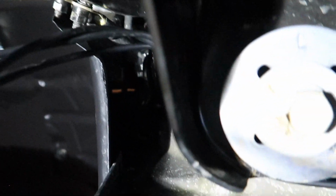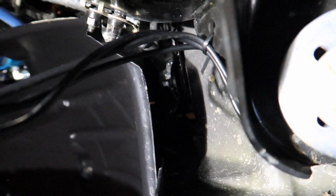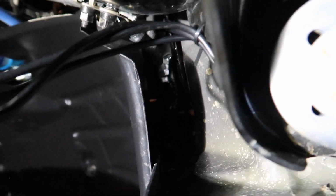And once it's up there, it's pretty much at the battery on this side. So on the other side, and I'll show you the other side, once you come up, you actually have to come across the top of the engine. The one thing I do need is my two cables are plenty long, but I've got one that's just short enough now where I need an extension. So I'm going to have an extension connected here before I pull it up.